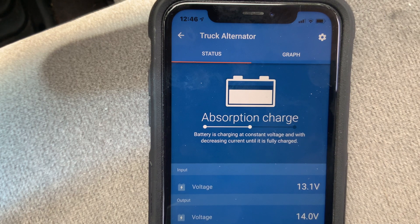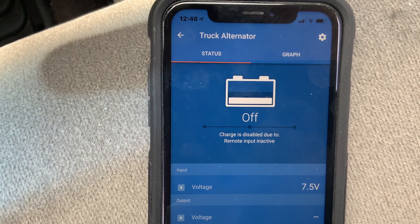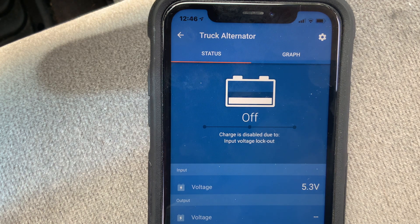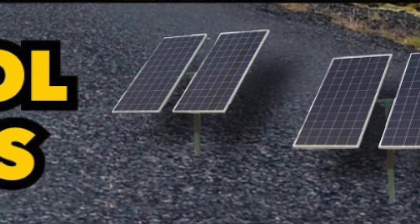If I shut the truck off right now — there, I'm off. It automatically detected it and isolated itself from the circuit. When the alternator kicks out, the voltage drops down to your normal battery voltage, and this is a smart device so it knows that and just switches off. Totally automatic, works really well — Bluetooth, can't beat it. I love the Victron products. Look into all the other stuff they have — pretty amazing. Their MultiPlus, their MPPT charge controllers, and so on.